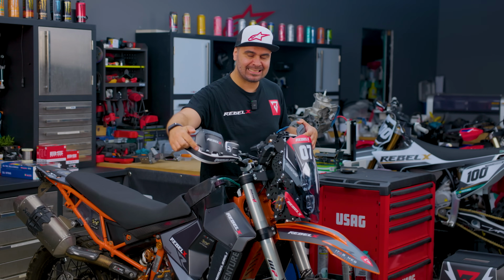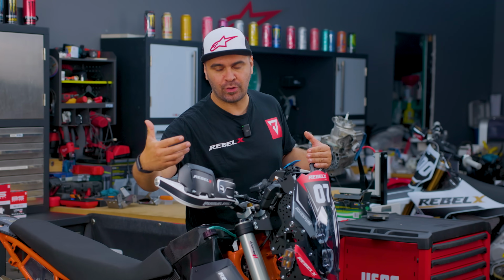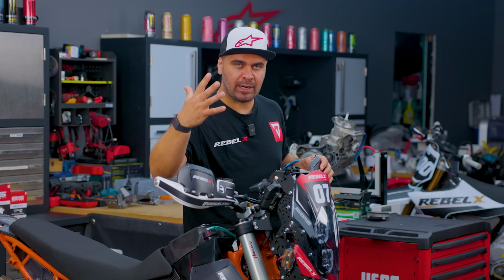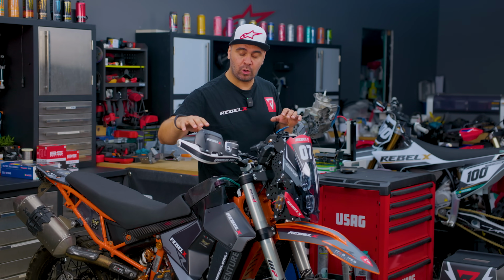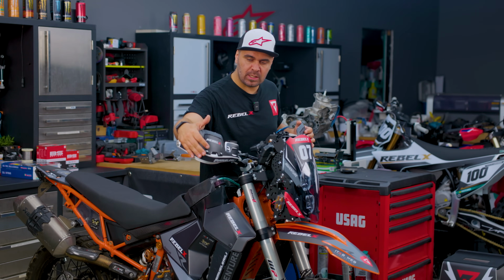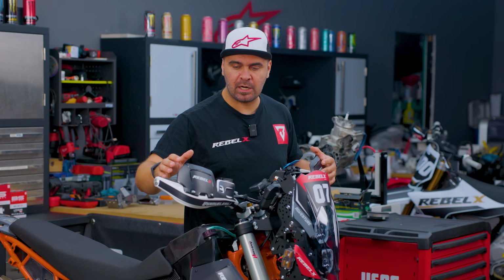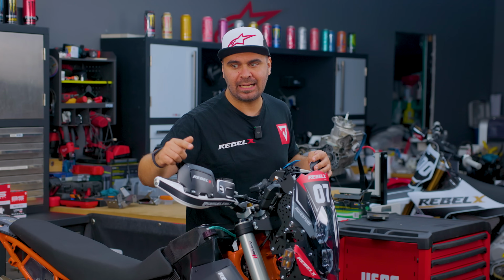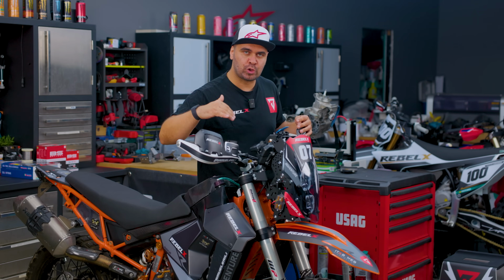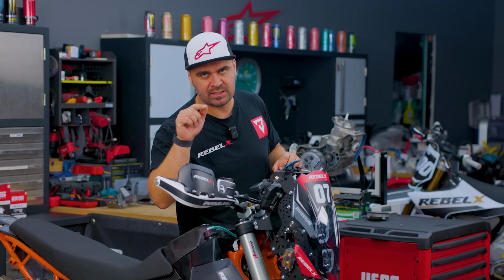But being in plastic and having this inside reinforcement, what will happen in case of a crash, when you have the aluminum handguards, they can really damage your hands badly, but not only, they can also twist very easily the handlebar. With these plastic ones, the plastic will bend to an extent where it won't damage the handlebars and will keep your levers protected, but also in case of a crash, if your hand ends underneath, for sure the damage on your hand will be less. This is the reason in Dakar everyone uses this model.